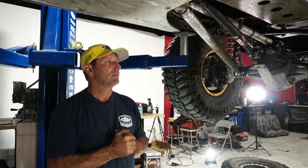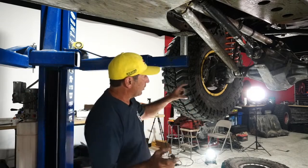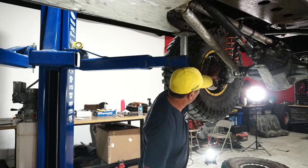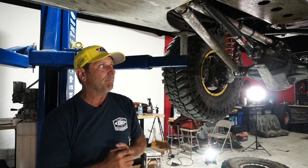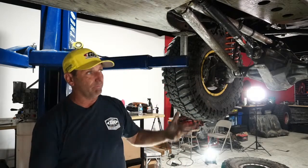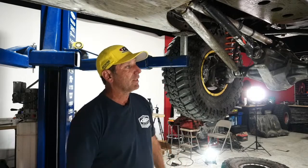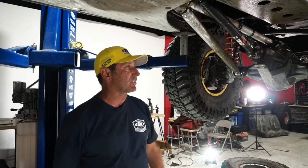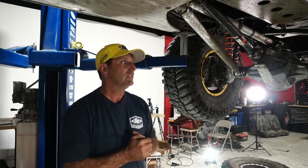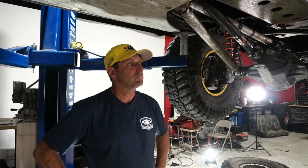Q&A: Kingpin or ball joint on a Dana 60? I've seen both break, so that whole theory's out. What I don't like about a kingpin is that it's very narrow — this ball joint setup at least spreads it out so you have more of a bite. There are aftermarket knuckles and joints available, you can spend a fortune on super stuff, but for the most part on a 40-inch tire we've had great success with this setup.